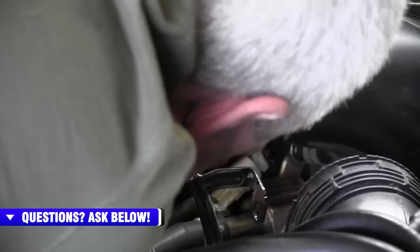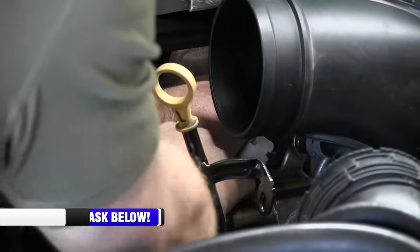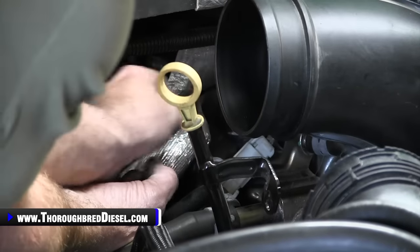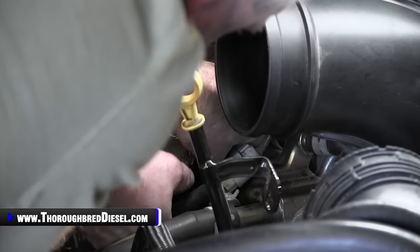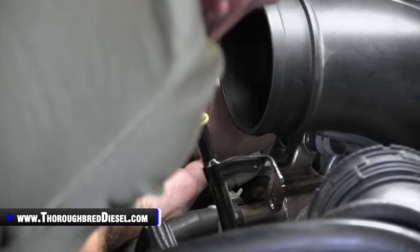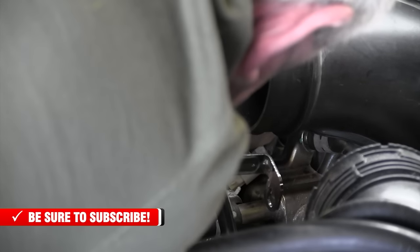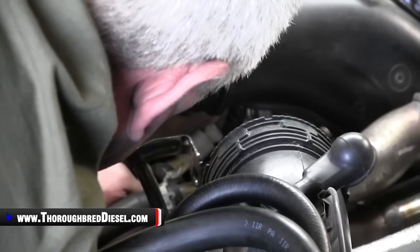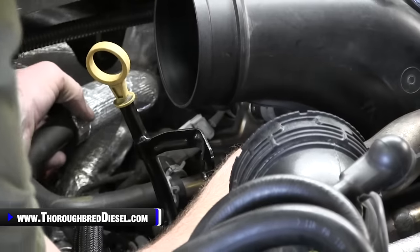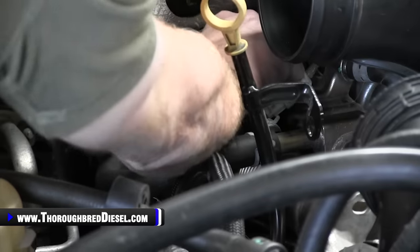What I'm doing here is just lining up the gasket and putting pressure against the up pipe and then switching out my hand if I can get the bolt through the gasket. And once I've got the gasket, it's pretty much a cakewalk. Well, not a cakewalk, but it's a hell of a lot less difficult. The problem is you run out of hands trying to hold the pipe up. So we got one, and that has our gasket still in there. Yes, it is still in here.